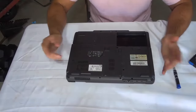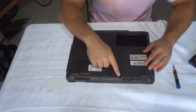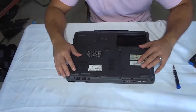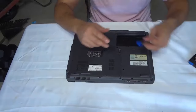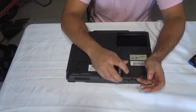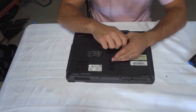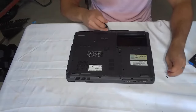If you look at the bottom of the laptop you will notice that there should be one or multiple removable cases. Right here is one of the removable things I was talking about. There may be more than one, and if so you'll probably have to open all of them to see which one is the correct one. To remove it you simply use a screwdriver — there are usually about four screws holding it into place.